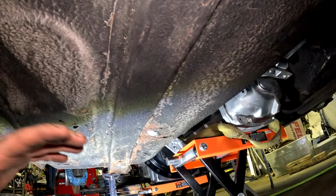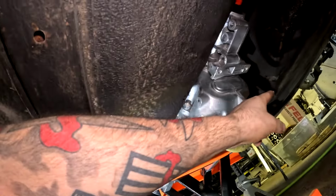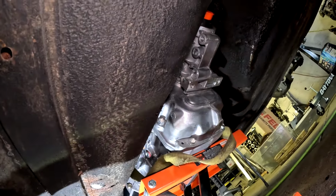We do need to connect the subframe together. So what I'm going to do with that is take an inch and a half to probably inch and three quarters 120 wall tubing and attach it up to here, and then run it all the way back to link it together with the subframe in the back of the car. And then that will give this thing plenty of strength. But I'm going to do even more than that. I'm also going to make a tube that runs across here to over there to the other tube that'll be on the other side to link the chassis together. And I will then make a detachable piece that comes out from right here and will attach to the transmission, therefore strengthening the chassis and providing me a transmission mount for this thing.